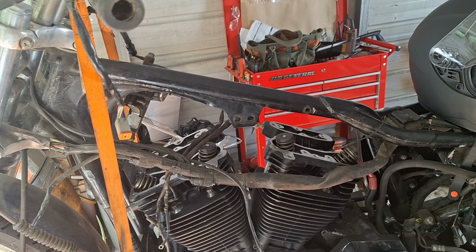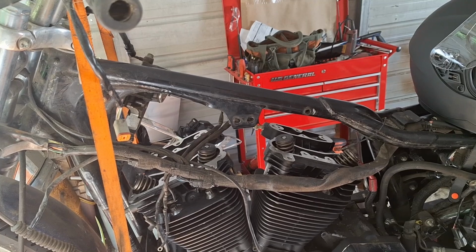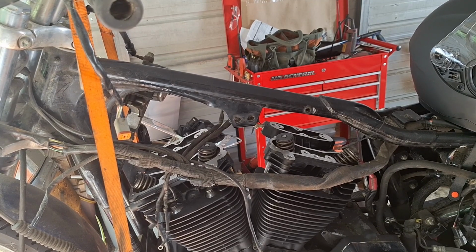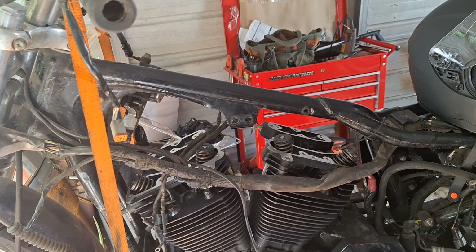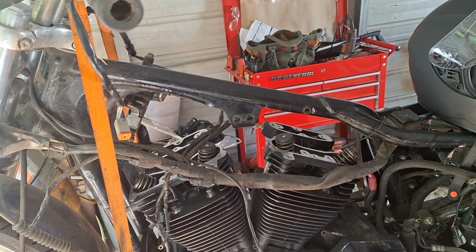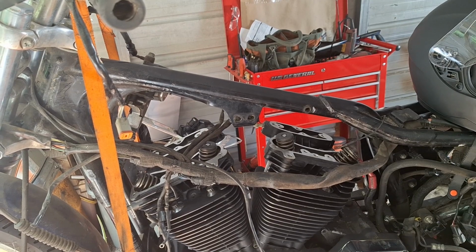And you're going to torque them to 14 foot. You torque these in stages, so you're going to torque 14 foot-pounds, and then 22 foot-pounds, and then 35 foot-pounds, and then 42 foot-pounds. So with the stock Harley, they want you to 7, 14, and then a quarter turn, torque turn method. This is the way they originally did them when they first came out with Evos. 42 to 45 foot-pounds.